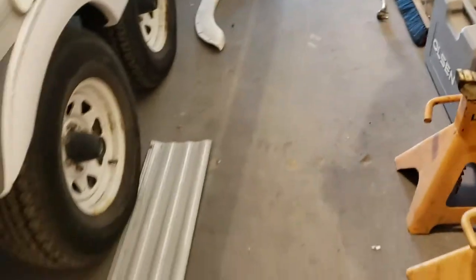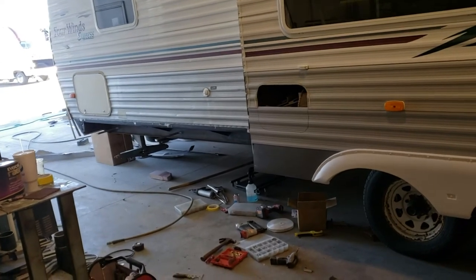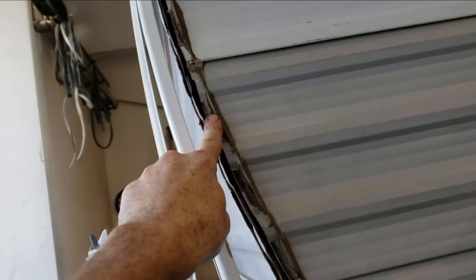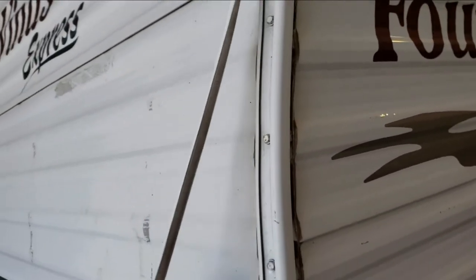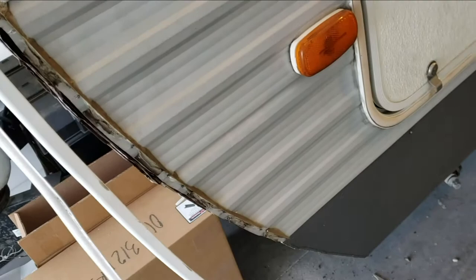And like that it's done. Here's the new one, there's the old one. I'm not going to throw away this metal yet because it has the screw holes in it. I think we're about ready to put that J-wrap on — before I put that on I'm going to have to cut out the front of it so it fits that radius. I used the body saw to cut that off — a lot easier than trying to use tin snips. Now I just need to clean off the sealant right here. I'll probably back out some of the screws all the way up to here — the front molding seems a little loose, which definitely wasn't part of the job. We'll put some longer screws in with some putty.